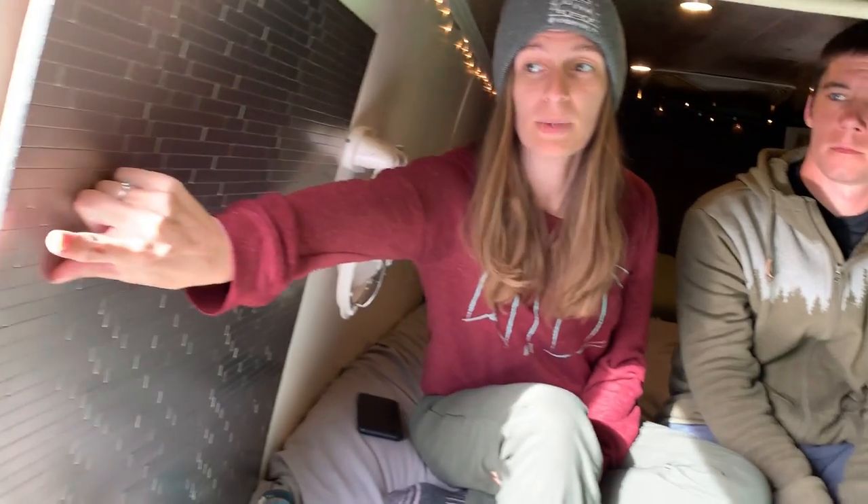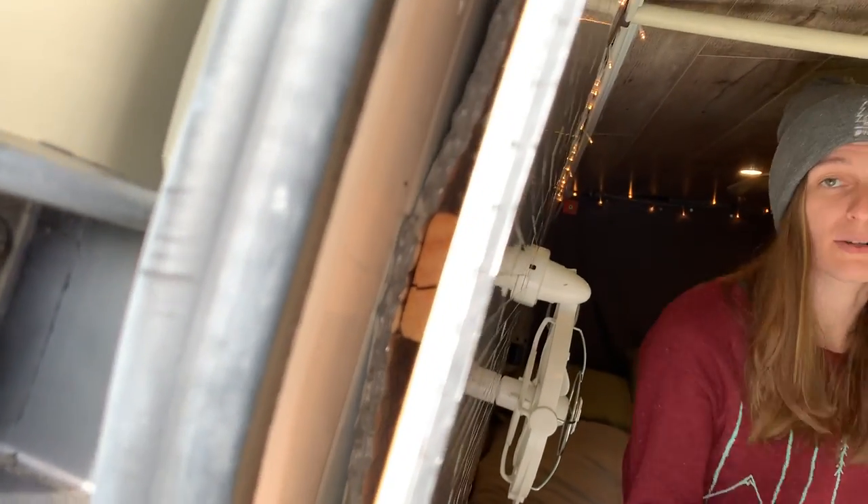From a condensation standpoint, when Rainer was upfitting our van he made sure everything is breathable. We have rigid foam and reflectix in our walls but nowhere is it sealed. In a household the mindset is to seal everything — vapor barrier, lock it in, prevent airflow. In vans, because it's impossible to avoid moisture, it's really important to let it breathe, so under our walls is quite open. Because there is breathability, the inevitable moisture that comes in has the ability to get out. Where you run into big problems is if moisture gets somewhere but has no place to escape.